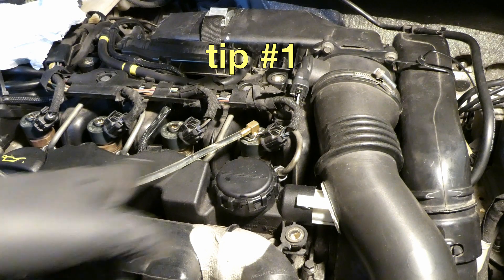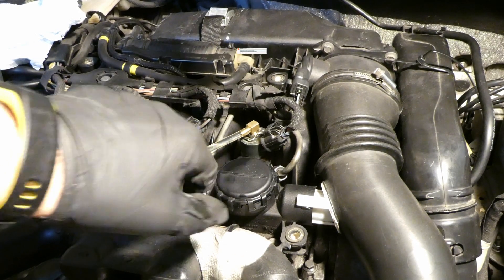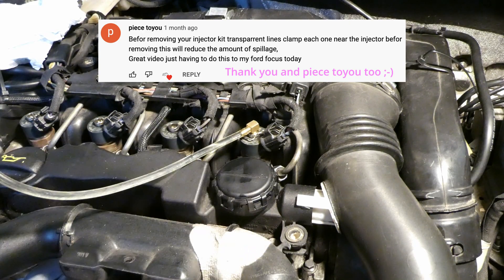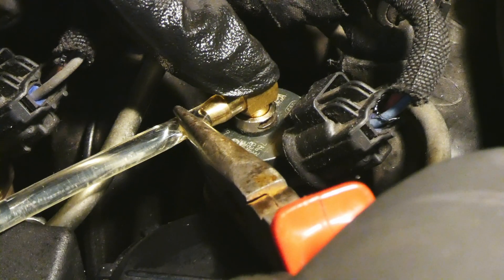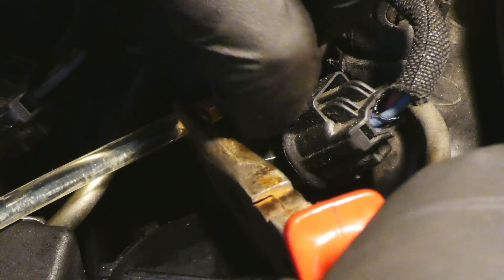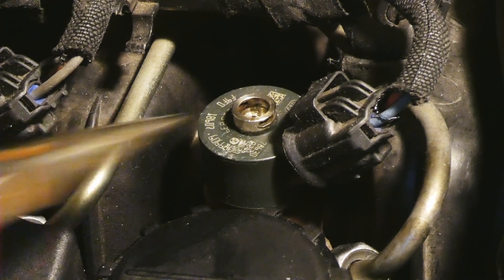Once you've done that and this is full of fluid, taking this off always leaks in my previous video and all my experiments — but I had a really good tip from one of the comments. Here's how you take it without spilling any liquid. You first take the bracket here that holds the clamp, use long nose pliers, squeeze it somewhere here and then just lift it. And there is no liquid spilled anywhere — no diesel spilled around there. Squeeze it, pull it out and it's pretty clean.